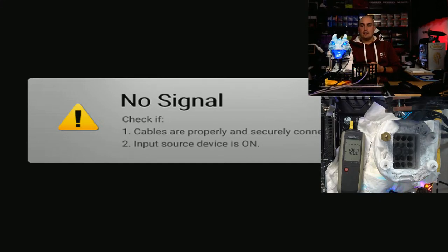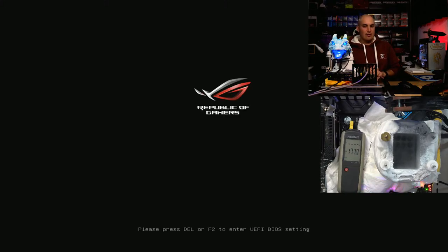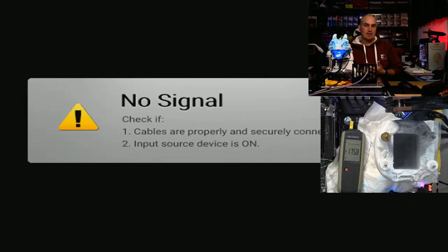Well, I don't think it's dishonest, since I'm selecting the chip for extreme overclocking. And actually, the one that I want to sell can do 1900 FCLK at ambient, and this one cannot. So for daily use, the one that I'm selling is better than this one, because I just need the resilience to extreme cold. So I may sell a chip that performs extremely well at ambient temp but is bad for extreme overclocking. A Ryzen like this will probably be used at stock, so the silicon quality is not a big thing for a Ryzen that is usually used at stock speed. It's not like Intel, which can overclock a bit more than another.